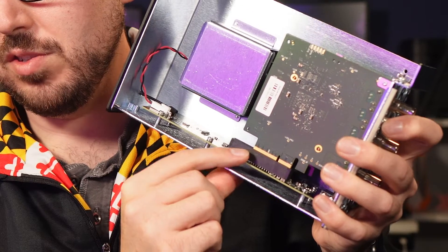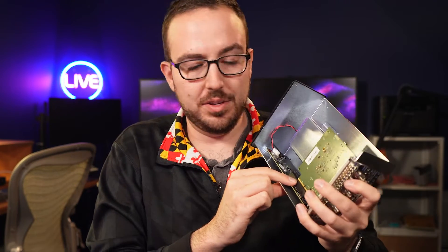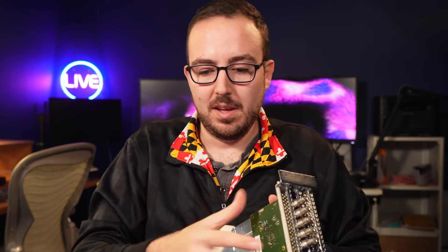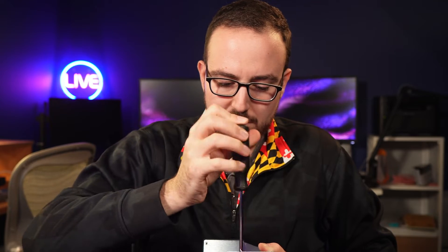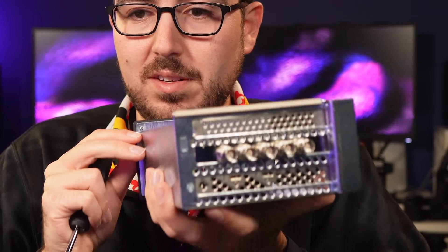Very important here: you'll notice there are two sets of golden connectors with a little notch in between. Make sure that notch lines up with the notch that's built into the receptacle, otherwise you're going to break the card before you lock it in place. Now that I have it lined up, I'm going to push down gently and you'll feel it kind of snap into place — it shouldn't need too much pressure if you line it up properly. You'll notice there is an open slot for that screw to lock it in place. Once this is in, I'll take my screw and lock this back in. It certainly helps if you have a magnetic screwdriver. Just wiggle the card a little bit to make sure it's locked in, and our screw is locked down in place. You'll have your SDI connectors coming out the back just like this.